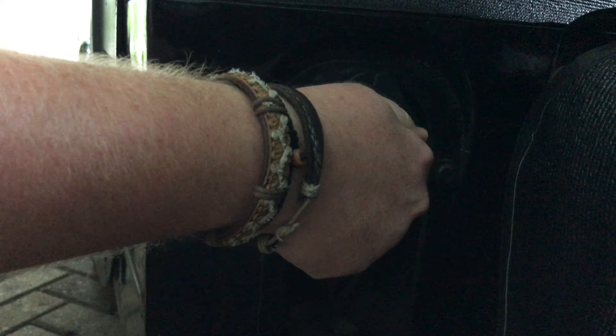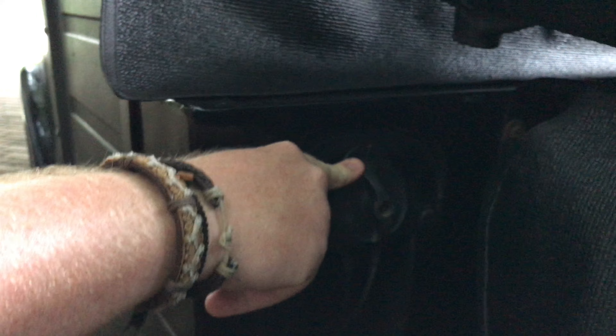Every tuk-tuk comes with a 6–9 litre petrol tank. This black selector here — in the ON position, your main fuel supply is connected. Turn it 90 degrees and you've turned the fuel off. Turn it another 90 degrees — opposite to how you normally have it — and you've engaged a 1.5 litre reserve fuel tank. That's great for if you run out of petrol and just need to get somewhere, giving you another 30 kilometres or so to find a petrol station. As soon as you've filled up, don't forget to turn it back to ON so you're back on your main tank.